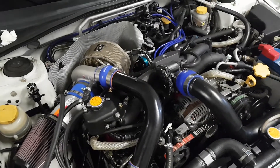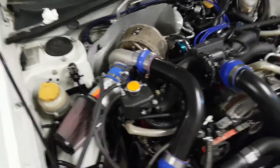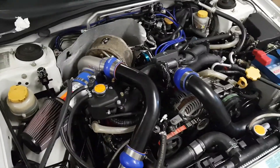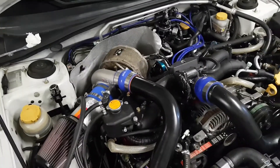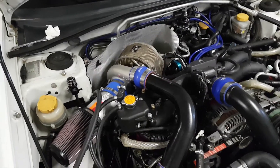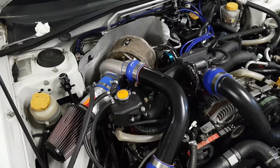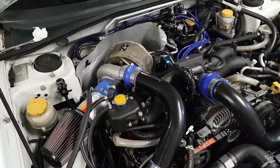I couldn't get the air-fuel mix right at all. After today, after really tuning it and doing lots of work with injector latency and testing everything, the only other thing I was thinking it could be was the fuel filter being dirty. But everything seems fine — fuel pressure is fine, everything's fine.